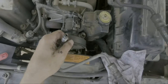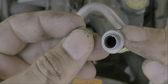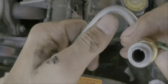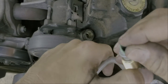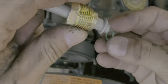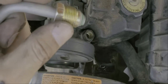The replacement kit comes with a cap and o-rings. On this XJ style, the o-ring doesn't need to go past the end of the flare — you just walk it over the edge so it sits in position. There's one on both ends. Walk the o-ring over carefully, making sure you don't cut it or pinch it as you're doing it, then you're ready to install.